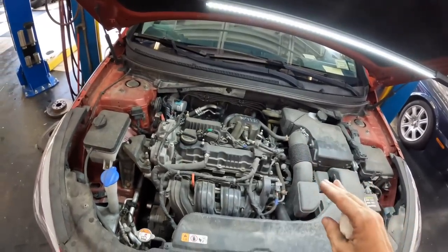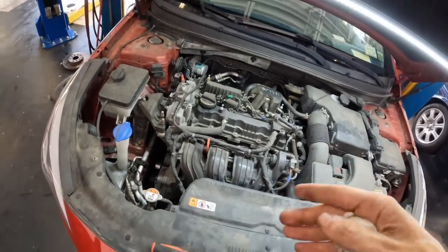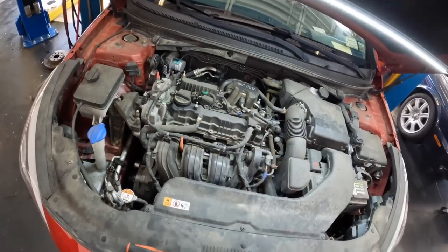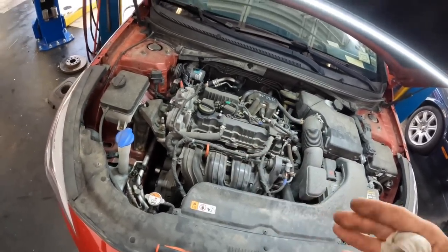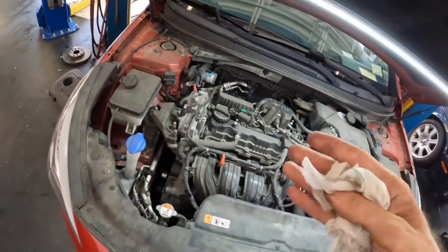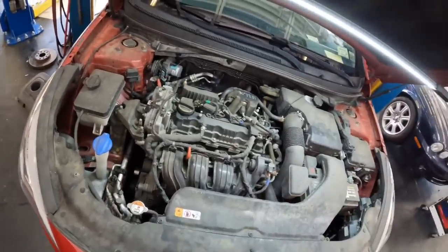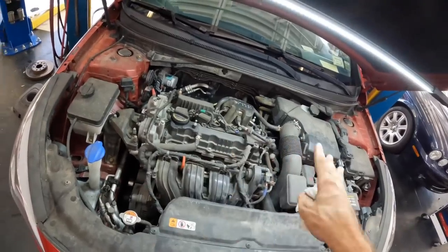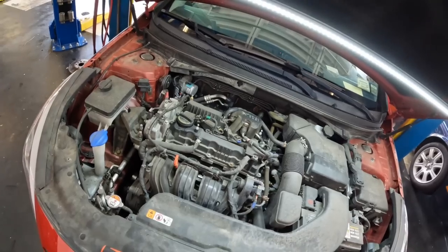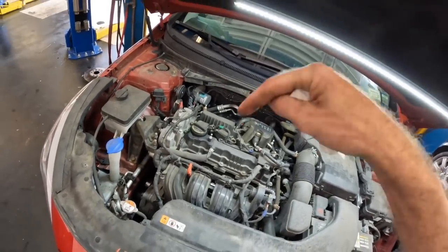I am not going to clear out the trouble codes. One of two reasons. Number one, if somebody else gets a hold of this car before I see it again, they're gonna need that information. And number two, I don't want to create the illusion that the car is fixed, because turning off the light can be received as, oh, no more light, no more problem. And I don't want to set the situation up where it leaves here with the light off and then the light turns back on and we just end up in one of those negative places. So I'm going to leave the light on. I'm going to leave all the code stored. We're going to put a gas cap on it and put the cover back on, and away she goes. And I do believe I will see this car again next week, so this is going to be continued later on when this thing returns.